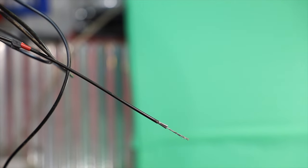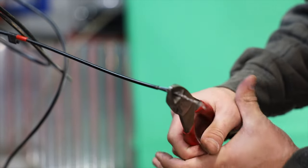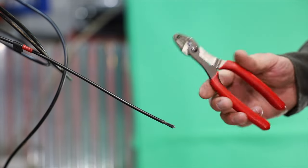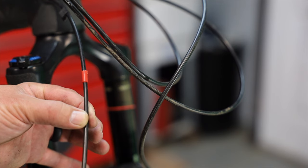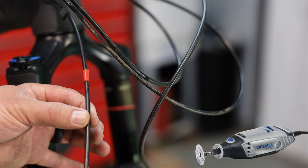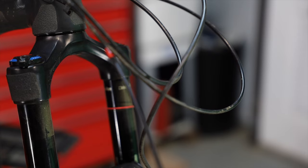I was able to run the cable right back through. The problem with cutting cable like this is I don't recommend using wire cutters — and I'm not succeeding right now. So I'm going to pull this cable out roughly this long, which is much longer than where I'm looking to cut. Since I don't have good shears, I'm going to use something that cuts really fast — either an angle grinder with a cutting blade or a Dremel with a metal cutting blade. I think the Dremel will be the smoothest and easiest way.